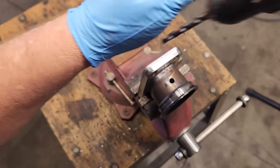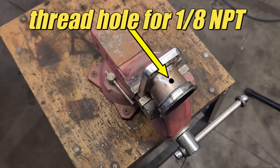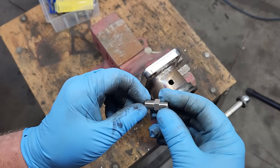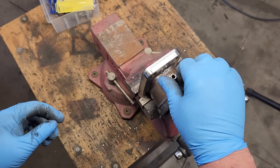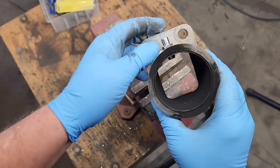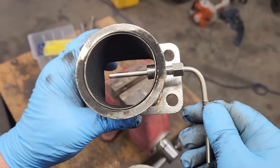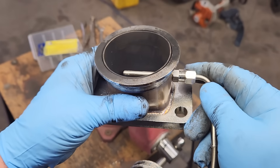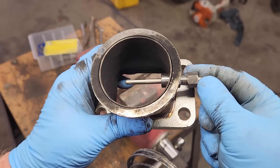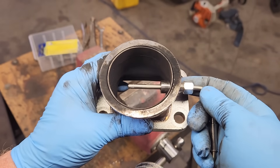On modern gasoline-powered cars there's usually some sort of gizmo on the dashboard that provides instantaneous readouts for the fuel economy. I suspect on modern diesels with common rail injection there may also be such a gizmo. On an old-school diesel with mechanical injection, there's no feedback from the engine to indicate if the engine's operating efficiently. On a diesel you can't fit a vacuum gauge, and that's because diesels don't make vacuum in the intake manifold.